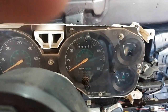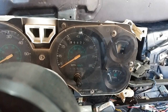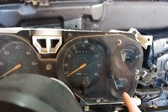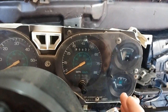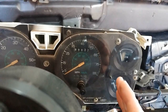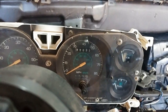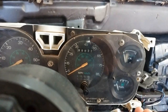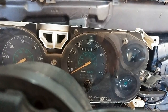All right, so you can see the oil gauge. It's melted somewhere along the way, so that does not work. But I know there's oil in there, and I know it keeps oil pressure. And then the fuel gauge does work, but it's not calibrated right. The resistance in it is wrong. So when I'm at about 1/3 of a tank, which I think is roughly 4 gallons, it goes up to somewhere around half. So with a little more calibration of myself, knowing that the fuel tank reads about a 1/4 tank high is doable, just to know that I'm not going to run out of gas.